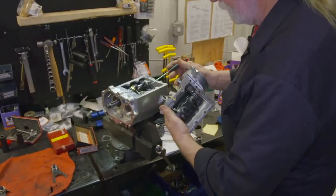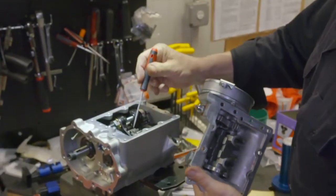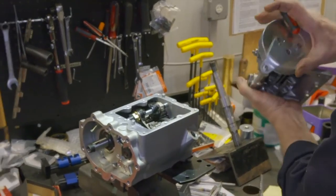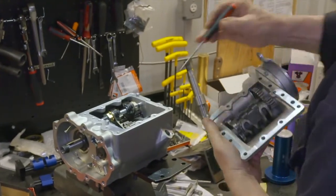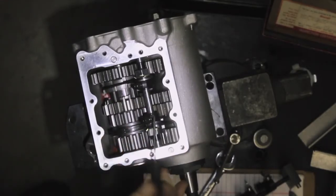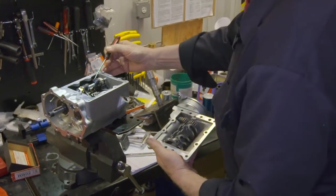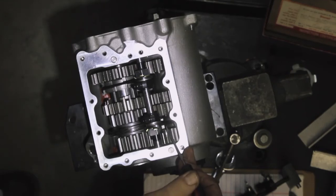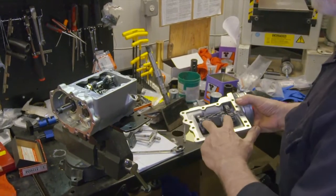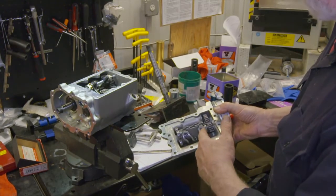A little bit closer demonstration here of the ratchet top mechanism in respect to the forks to show you exactly how this will function. As a person depresses their foot down for first gear, you'll see how this will swing this fork over into first gear, as you can see here now. Over here on this side, we remain in a neutral stabilized position. Third and fourth are in neutral. It's all done simultaneously on one cam. As this slipped ourselves over to first, this remains in neutral, this long slot.